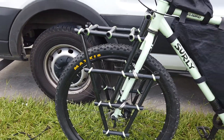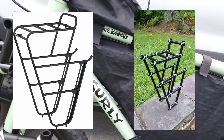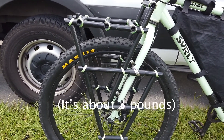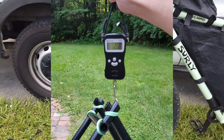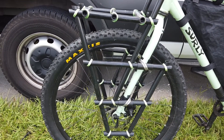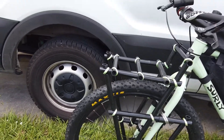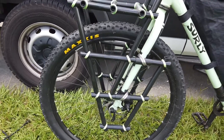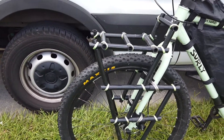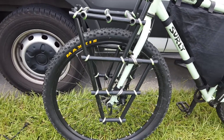I modeled this rack, roughly speaking, against the official Surly metal rack — Surly is the brand of the bike, and I think Surly makes the rack itself too. I forget the numbers exactly, but it was something like three and a half pounds for the metal rack, whereas mine is maybe two and a half or 2.75 pounds or something like that. So the point is my rack is actually lighter than the metal rack. And even though it's obviously more material by volume, the PVC is super strong. This bike has fallen, ran into trees — it's very flexible too, so it kind of goes with any kind of punishment. Whereas a metal rack might have a tendency to bend or break at the joints, and there would be no way to really fix it if you were on a long bikepacking trip.